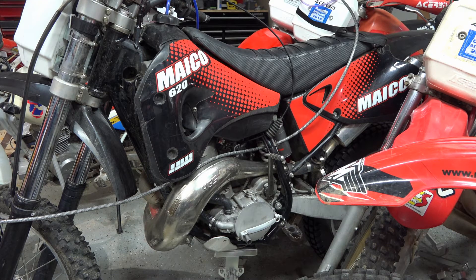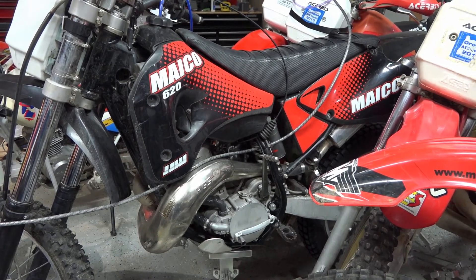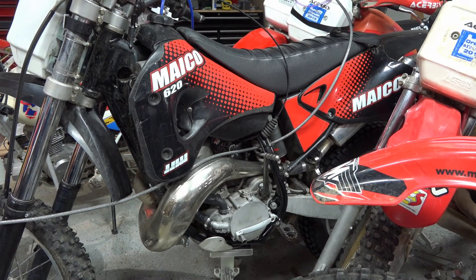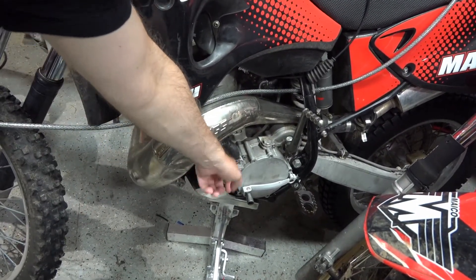The scale benefits I find: number one, Evans won't boil over. A lot of people think that boil over is useful because you can see that the engine has overheated. But sometimes you don't notice it boil over because you have a hose that connects to a coolant tank in the back. I didn't know sometimes it was overheating, but it was filling the coolant tank in the back - so I was losing coolant and didn't know it. If you keep overheating the bike and it's getting close to having all that pressure in there, those hose clamps are more likely to fail.